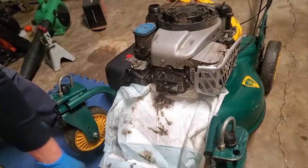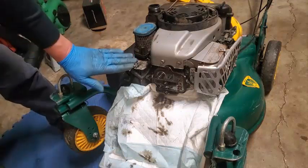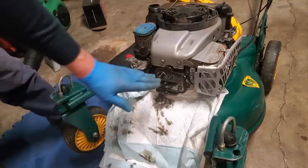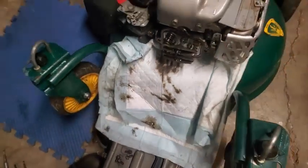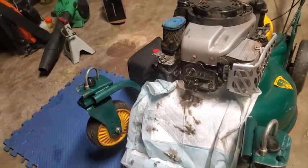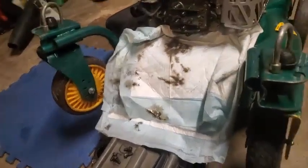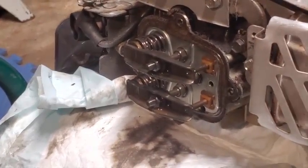This is a good time to inspect the oil - they'll have some oil residue, sometimes it collects in that rocker cover. That one's definitely due - looks like the muddy Mississippi down there. I wiped it clean before taking that rocker box cover off. Up top where the blade brake bail is, I wrapped a rope around that like a strap. Here's just where the rocker arms are and the valves and valve stems - that's the top of the valves. You could call it the stem; the other end is the actual valve that seals the compression and combustion in there.